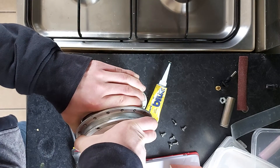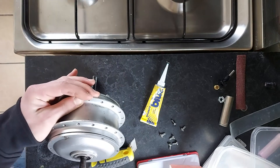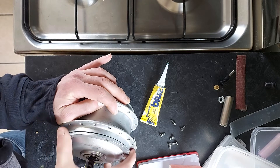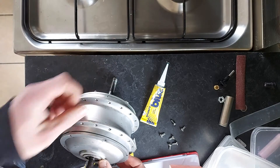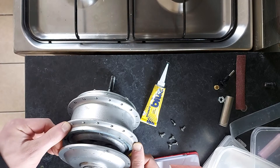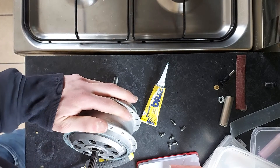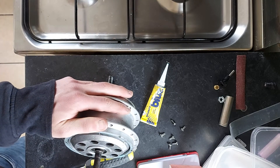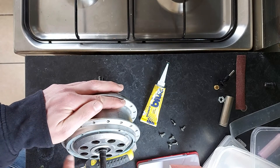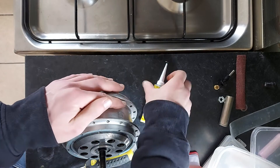You've got to get the side off, and this can sometimes be quite difficult to do. I've actually already done this to the hub motor, but I'm just doing this again for the purposes of the Electric Bikes Facebook group, just to share how this is done. What you would do is take the side off the motor — you do this on both sides — and you clean the flange on each side with isopropyl alcohol, make it very clean, then dry it.